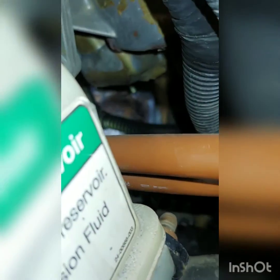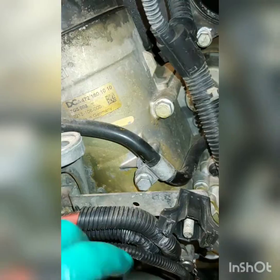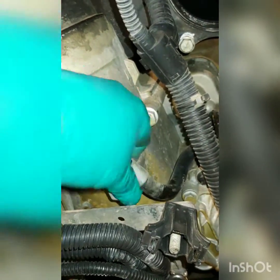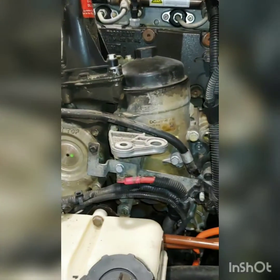You've got oil running down the side of the engine. Another common issue is this coolant line right here — the P-clamp starts to rub through and you end up with a leaking hose, which will probably put you on the side of the road.